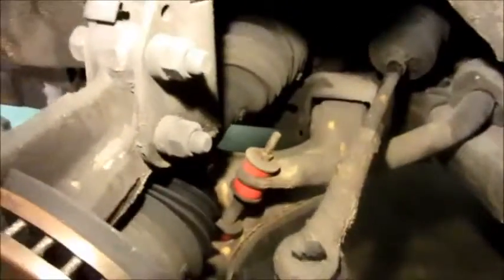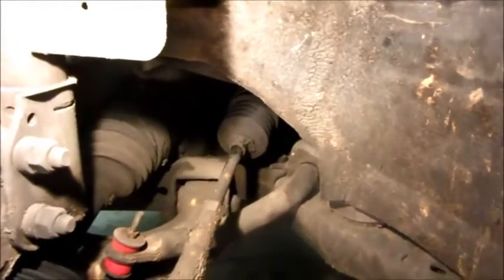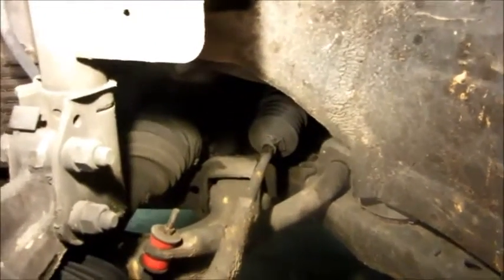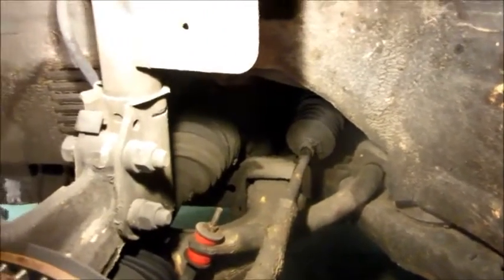When I got this car, it had bad struts on it, and I haven't changed them yet — it just has a really bouncy ride. I've got a new set of struts and also a new subframe. It connects right there to the body, and then goes across the front. Right up in there is where the front transmission mount sits. GM changed the design of those mounts between 87 and 88, and the newer cars have a much better mount, but they changed the shape of the subframe where the mount sits, so I've got to take all that out to do the transmission anyway.